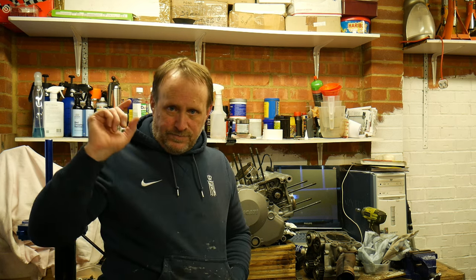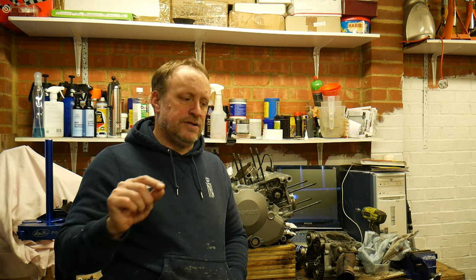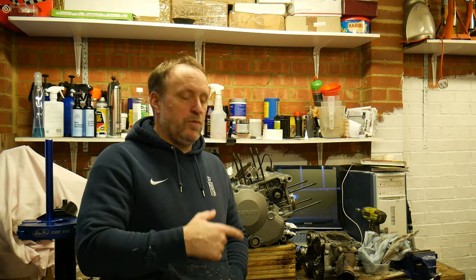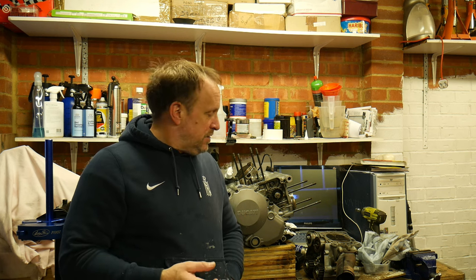So I'm going to check the cylinders, check the piston sizes. I will check the valve seats with a little bit of petrol in the bowl, to see if that leaks away, because that will give an indication that they need to be relapped. But there are no chunks of valve missing. It's now dependent on whether the new owner wants me to proceed with the work. Once we've had a conversation, I will be fully stripping the heads down and relapping those valves just to be sure. But there are no bits missing, which is a good sign. I do believe we found the culprit.